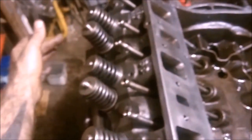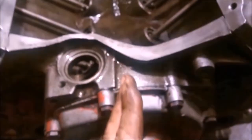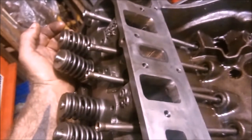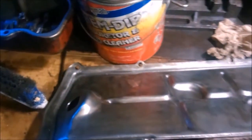On number eight cylinder, we're going to stand on the passenger side and put something in the hole — something that won't scratch things — to touch the top of the piston when it's near top dead center on the compression stroke, meaning both of these push rods are down and the valves are closed. That's where the timing dots are lined up and where it reads zero. You can feel when it starts pushing up and then starts going down again — turn it back to find top dead center. Sometimes the mark's a little off — you just want to check.